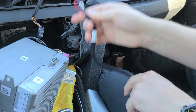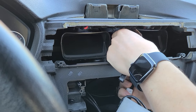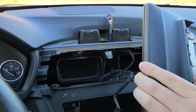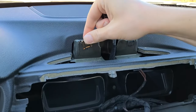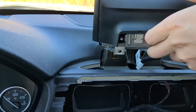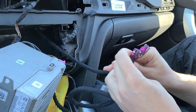This cable we're going to feed towards the screen. It's a good idea to feed it from the passenger side because we'll be hiding our module behind the glove box. Feed it through and bring it on top. Now take the original screen — when we removed it these clips also came out, so if that happens just put the metal clips back so the screen sits nice and snug. Clip the connection in and put the screen back. Now we have the two video cables to connect to our module.